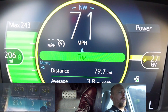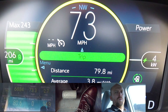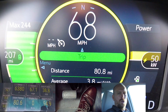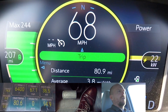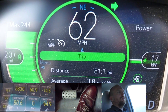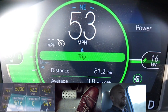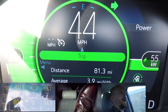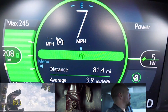For this first test, we're going to be in D. I don't normally drive there, so this will be new for me. It's really hard to get full regen in D, which is why I don't use it — a lot of times you're just not having the velocity or force to get it. I'm going to completely let off the pedal. As you can see, we're not really getting the regen that you would normally see — it's 16 kilowatts, and we're coming up to the light. I'll use the regen on demand paddle as much as I can and the brake for the rest of it, because it just wasn't going to slow us down from freeway speeds in time.